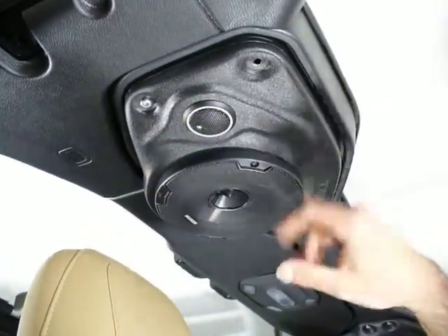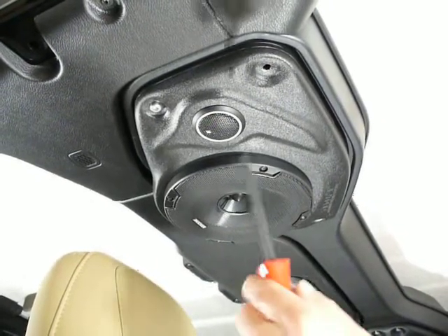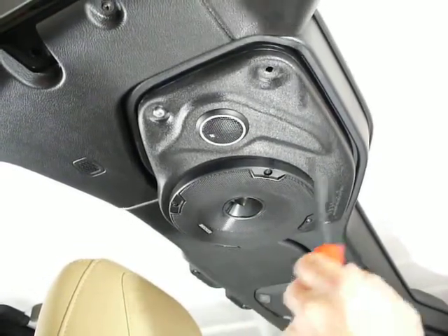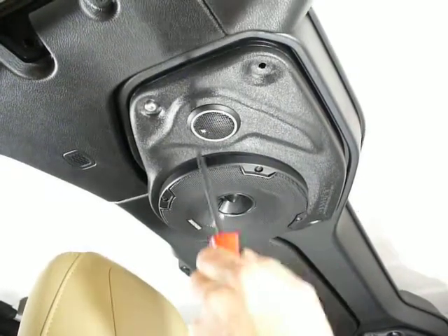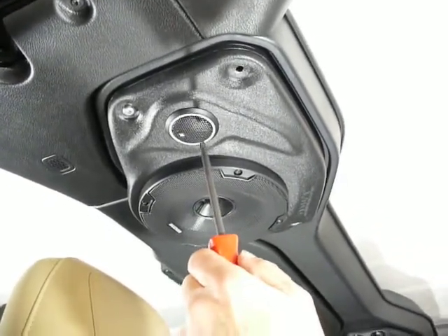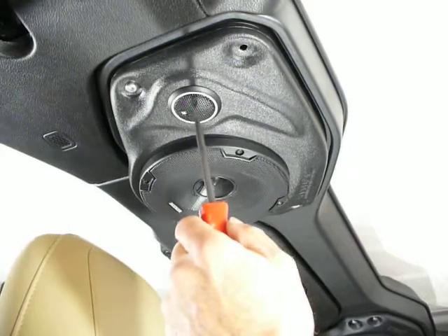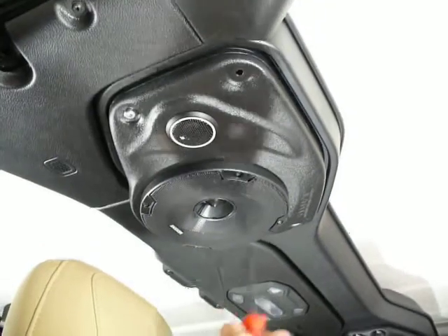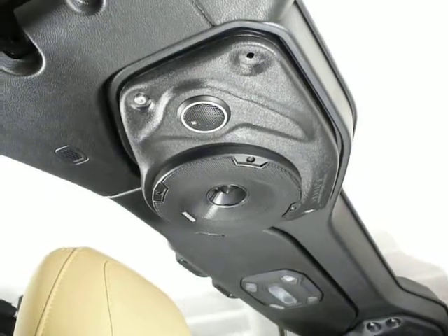All these holes are pre-drilled — you don't have to do any of that when you get the kit. With the Kicker component systems the tweeter hole is already cut, but if you have the Alpine premium system and you're dropping in your own speakers, you'll need to cut it yourself since sizes may differ. The Kicker needs a one-and-nine-sixteenth inch hole saw; you might need something different. There's a little dimple in the plastic as a pilot bit guide to line it up perfectly. The main speaker hole is already a five-and-a-half inch cut.